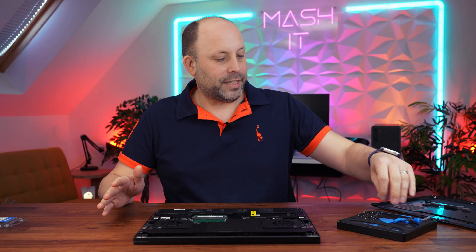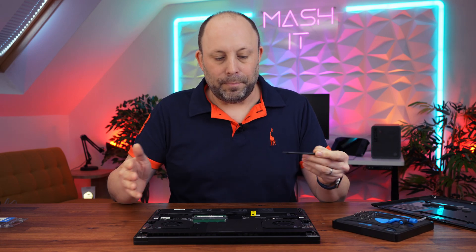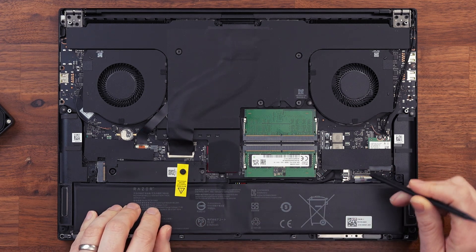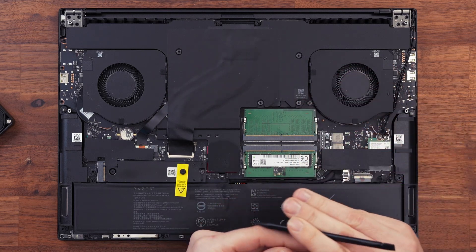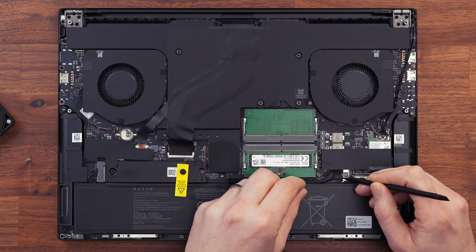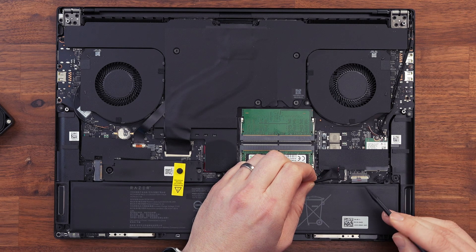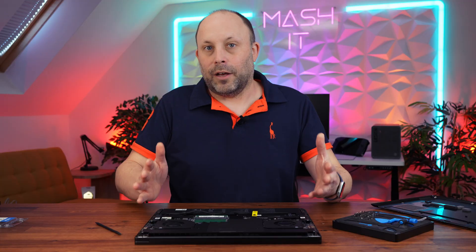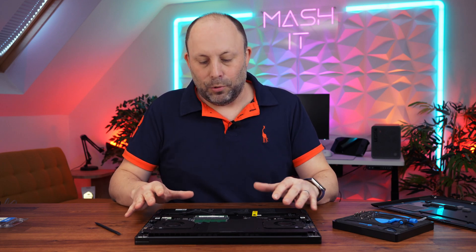First I'm going to unplug the battery cable so we don't do any damage to the system. Every laptop is going to be slightly different but they're all pretty basic — you need to find your battery cable, here's mine. I'm going to unplug that with a little plastic spudger. Do not use a screwdriver. Once we've done that we can take the RAM out. The battery is now unplugged so the laptop is safe to work on. Be careful not to use a screwdriver near the main board — you do not want to cause any shorts, and that's the biggest problem when working inside a laptop.